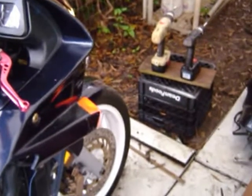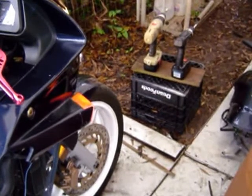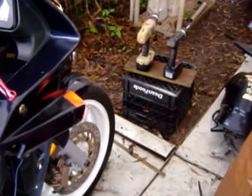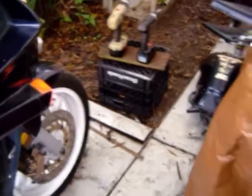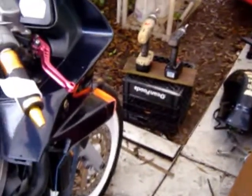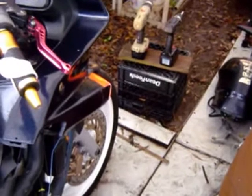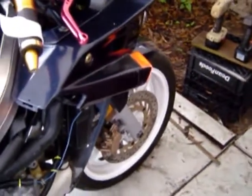It's going to be mixed 2.5 weight fork oil with automatic transmission fluid. The reason is the automatic transmission fluid alone is too heavy. I think it's about 20 weight, but it is too heavy. I cannot get these things to be a good ride. Handles great around corners, but it's too rough. So I've got a 2.5 weight fork oil. I'm going to mix it with the ATF, Mercon high mileage. Other than that, I've got new steering heads for it, new brakes.